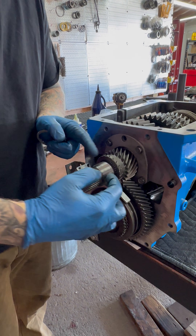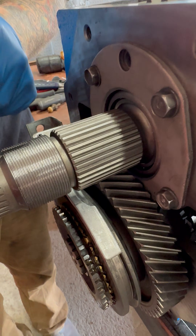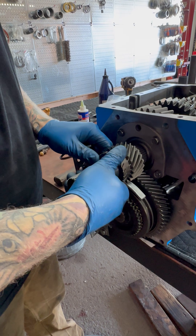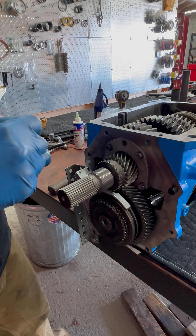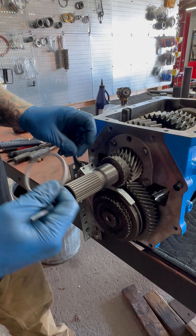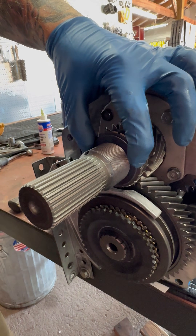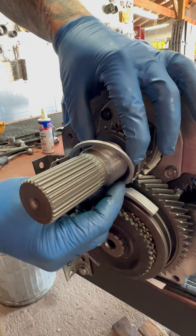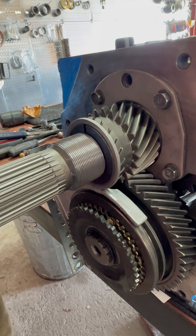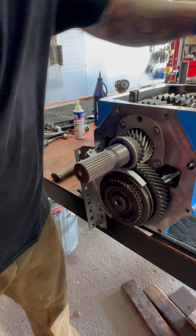The design of this main shaft has a gap with a machined recession in there. That's for these little split moon pieces. These little split moons fit right inside, just like this, and they fit into that recession. And then there's an outside retaining ring that goes on there. As you can see, as long as those things are held in place, that gear can't back off.